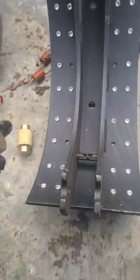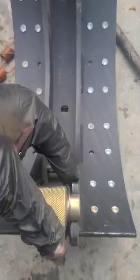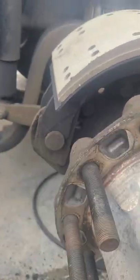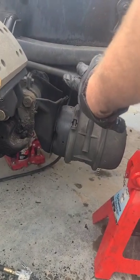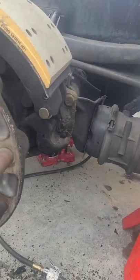These guys are just little springs — they pop on here, up in there, then they go in the side closest to your little post right here, you just gotta squeeze them in. It kind of depends on what side will let you fit it. It's gonna make more sense to put this side on first, and then I'm gonna adjust the slack adjuster, which will move the S-cam. I'm gonna seat this in our little brass fitting right there.